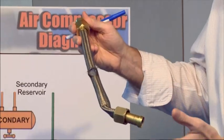We want to make really sure that the compressor is the root cause of the problem. Unless you have oil, fluid, and air coming out the side of the compressor — in which case you obviously have a compressor issue — there are a couple of things we'd rather have you look at first for less expensive and easier fixes. The first thing you want to look at is the air discharge and the air inlet hoses. You want to make sure they're free of kinks and excessive wear. I've got a discharge hose here that's pretty well beat up — we have a kink and some excessive wear.